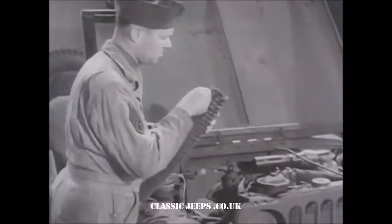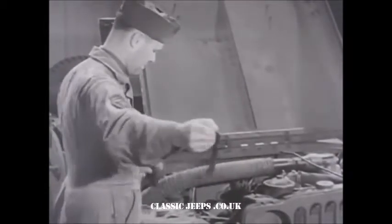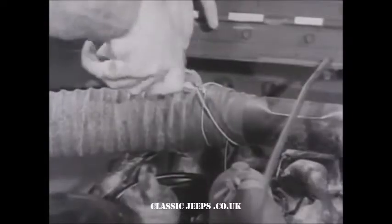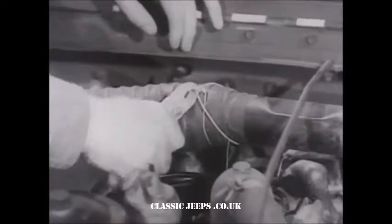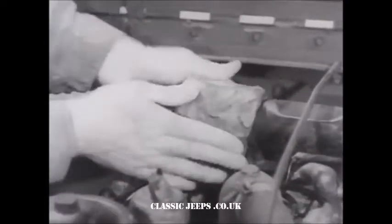Here, the driver uses rubber-impregnated tubing which has been split, forming slots on opposite sides. This permits the tube to overlap the air intake assembly. Then, using friction tape and wire, the tube is fastened onto the induction tube assembly, approximately 2 inches from the end. The wire is tightened on the intake assembly, and the joint just made is sealed over with AWC, making a watertight connection.